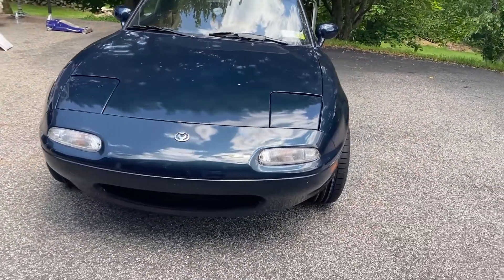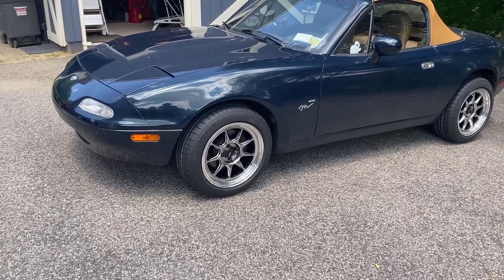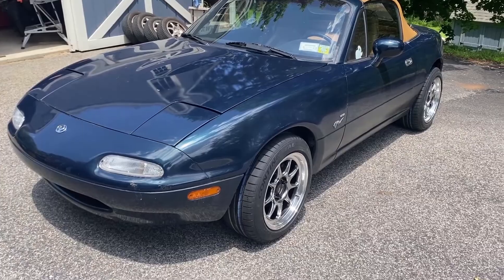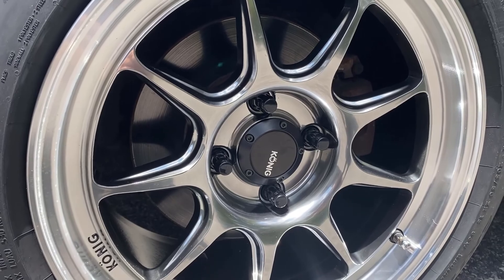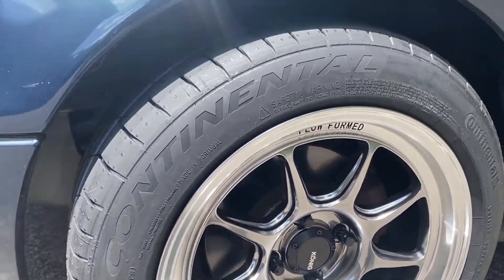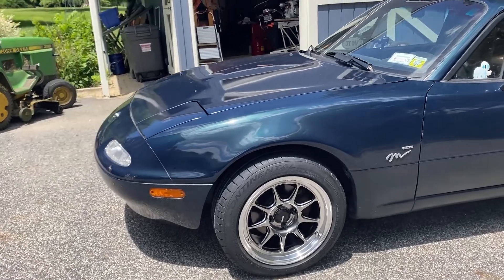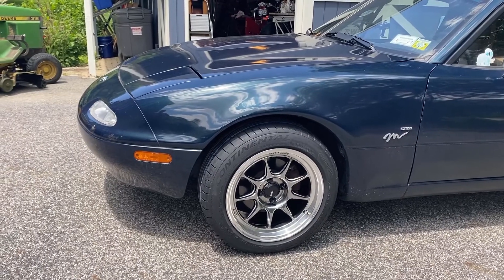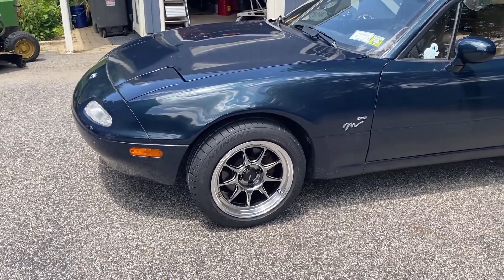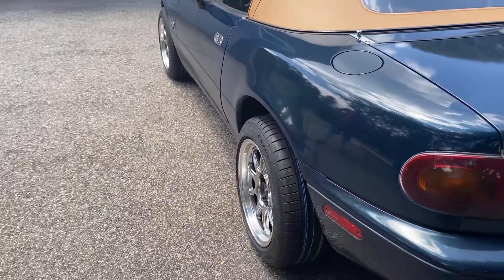I can go over a couple of things I experienced while shopping for these. I bought them on Fitment Industries, which was a great service — 10 out of 10, you should totally buy your wheels and tires there. Not sponsored or anything. They let me know I should get new lugs because the stock ones probably won't fit, and I can definitely confirm that. One thing I was curious about was hub-centric rings. As long as you torque your wheels correctly in the right pattern, you don't really need them, but they're about $10 so it's not too big a deal.